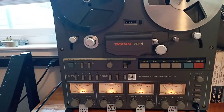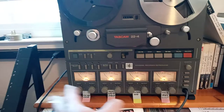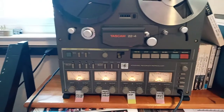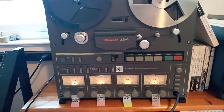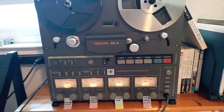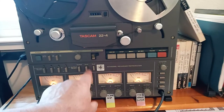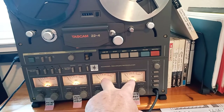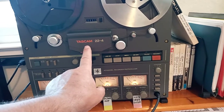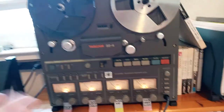This one we just did some master recording for a small band. You can easily plug four instruments or make a combination with the mixer and record four different channels, or you can record less than four channels like we do sometimes — one or two channels and then add additional channels later on using the sync feature, which means that pre-recorded channels can be reproduced by using sync. It goes from the record head directly, so the other two channels can simultaneously record at the same time without delay.